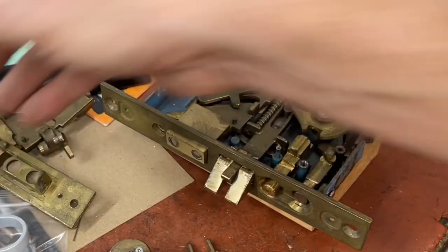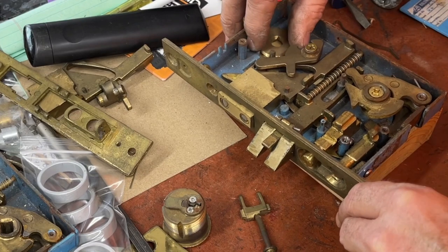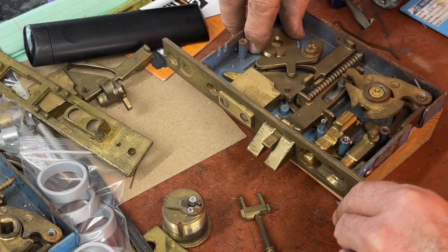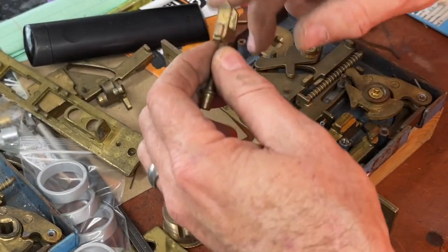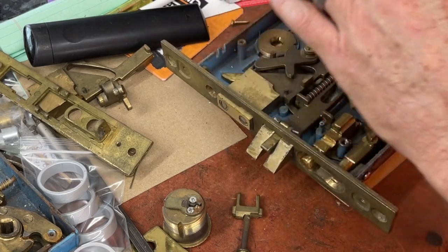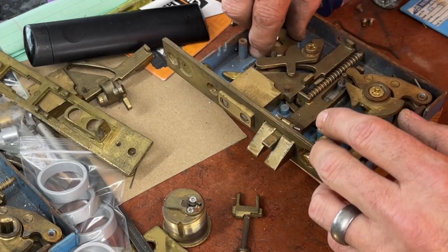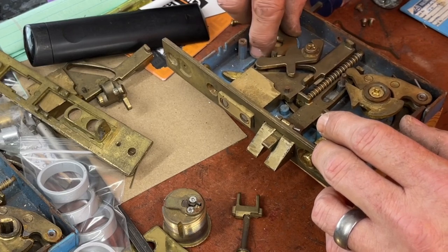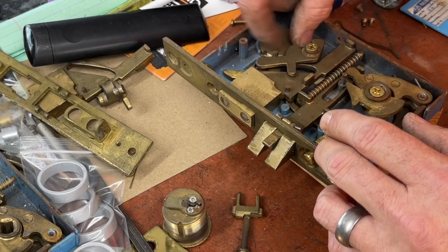We made another month — you know how hard that is! Alright, now we're putting the disc in because this is switching from double cylinder to single cylinder. What this disc does — because this has two sides it has to connect — if you're missing the disc when you tighten it down, it puts pressure only on one side. So you have to have this disc; it's a good idea to make sure it stays level when they tighten it down. These are kind of a pain in the butt to get started — I'll just wait until we take it off the block.